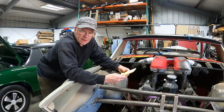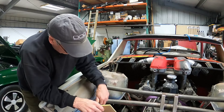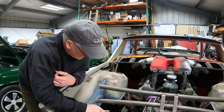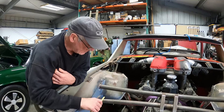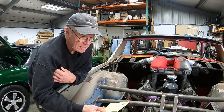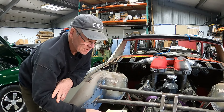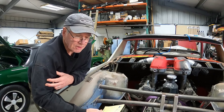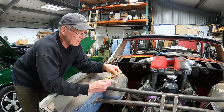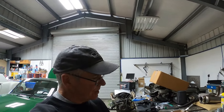So 50/50 and four inches of droop sounds like I'm in the ballpark — we'll know when I get this information over to those guys. They're also asking me for unsprung weight. Since I've got a free-floating wheel right here, I could put a scale under it and measure. I don't have the axle in yet so I might wait until all components are together. I love this stuff — it's been quite an interesting learning experience. Getting into oversteer, understeer, and all those adjustments is the next challenge once the hardware is sorted.